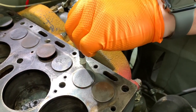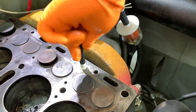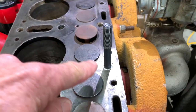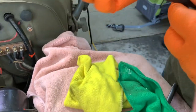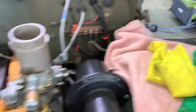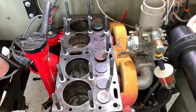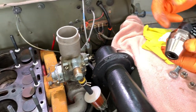You're just going to spin those in by hand — don't put any torque on those yet; they should spin by hand. Janton's got this one in and if you notice on these studs, there's a little shoulder on the bottom. Right here is where the shoulder is, and that's where your threads are going to stop when it goes into the top of the block. Most of them we've put in just finger tight, but every now and again you'll need a tool to get that last bit to the shoulder.